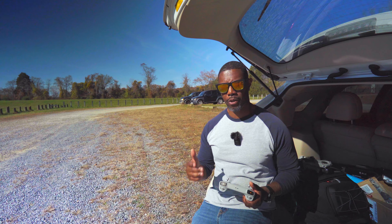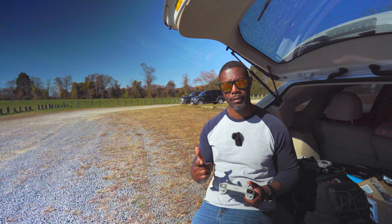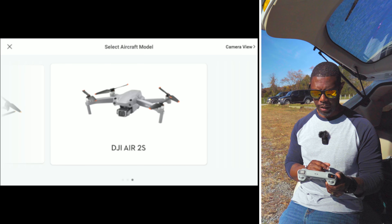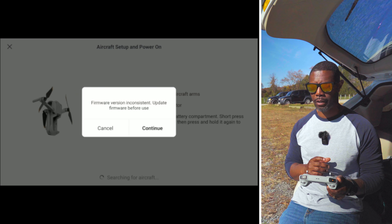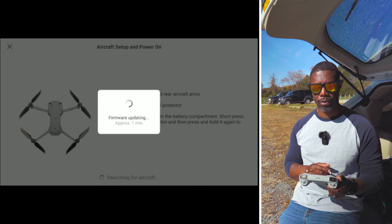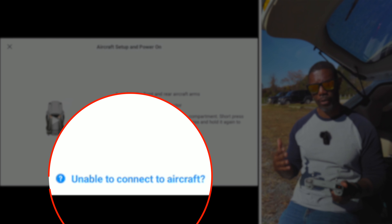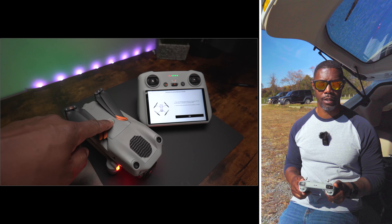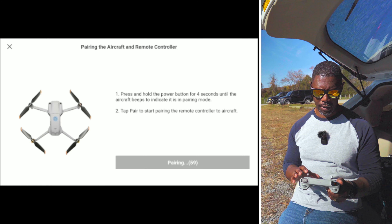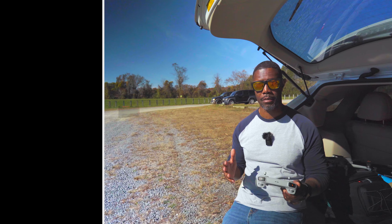Once that download is complete, go back to your DJI RC, power it on, and power on your DJI Air 2S. Once you get to your home screen, click on connection guide and then scroll over to the Air 2S. It'll search for the aircraft and you might get a pop-up saying the firmware isn't compatible — just click upload or download and let it go. On the bottom of that screen, you may see 'unable to connect to aircraft.' Click on that to start the pairing process. Hold down the power button for about four seconds on the Air 2S until you hear it beep, then click pair on the bottom of the screen on the RC. Once you hear it beep consecutively three times, that means it's paired.